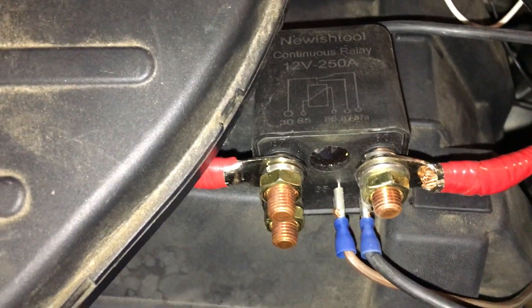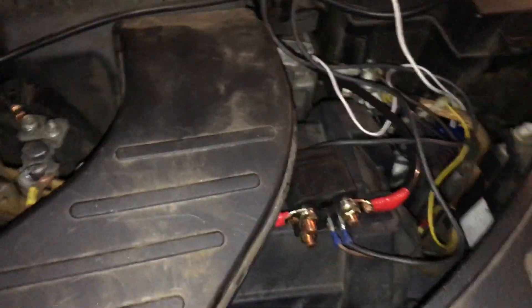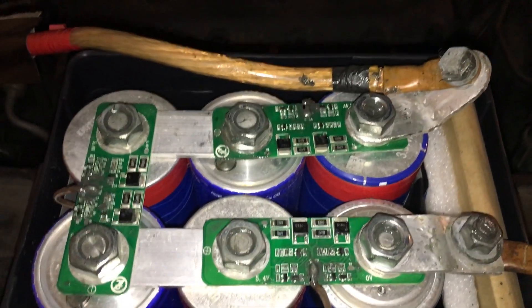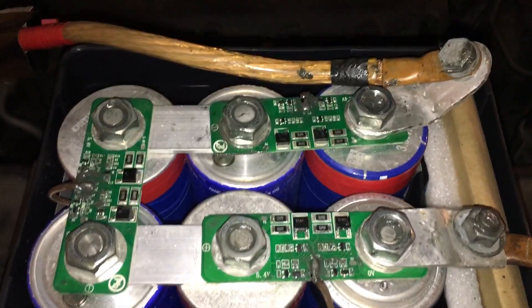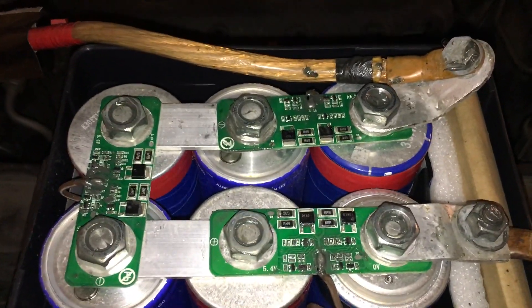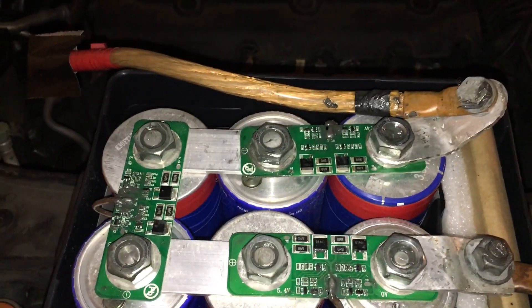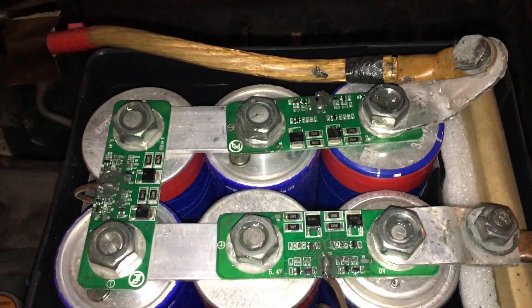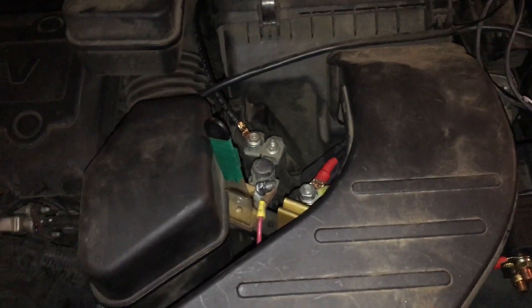The project I added was a heavy-duty relay so I could use it in conjunction with a manual switch. One of the things you have to take into account with ultra capacitors is that they do not store a huge amount of energy. They are capable of giving a huge amount of power in a burst, but they don't store a lot of energy. So when you turn off the vehicle, the accessories — the clock, radio settings, the engine computer — these things drain the capacitor bank.